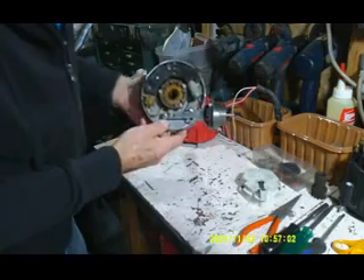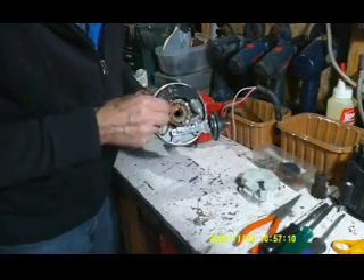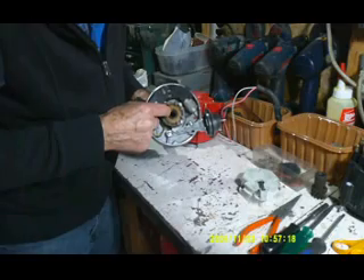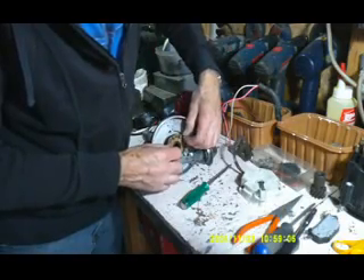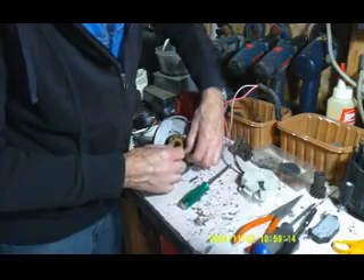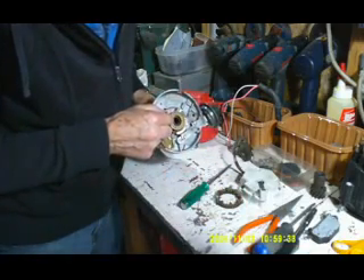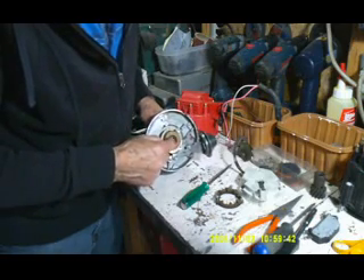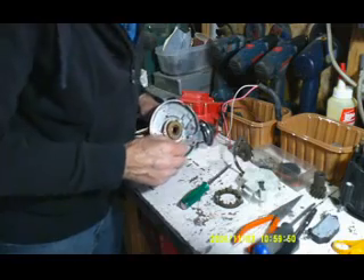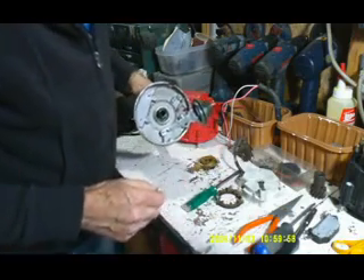Now we'll take all of this apart and we'll rebuild it. There's two screws here to take this module out, one screw here to take this resistor out, and then there's these three screws to take out the pickup coil. You can take these three screws out. And then there's a pin in here — this thing will just come off by itself, or you can take the whole thing off. What holds this in is a little ring around here that fits in the groove that holds this pickup coil in. I've already taken it off, and then the whole thing just pulls out like so. And there you have it.